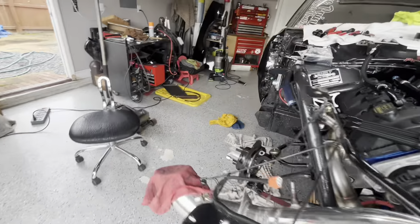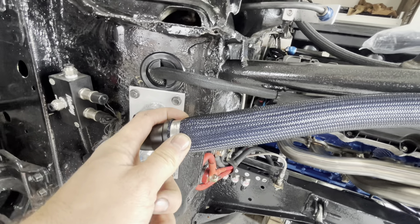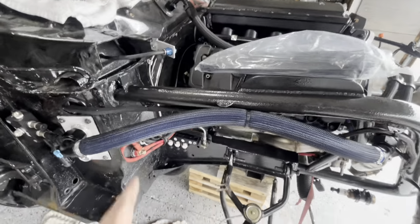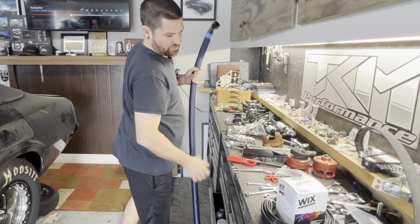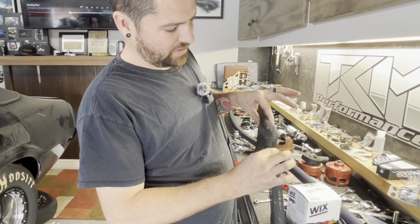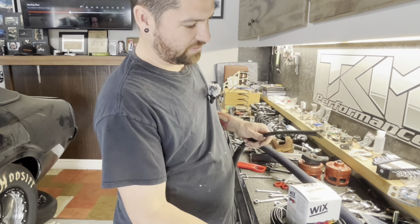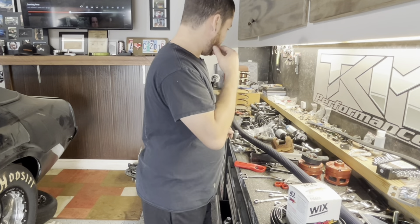On our lines I've got one made up and I'm about to show how I do it. We have a simple 90-degree fitting, then a worm clamp, then the braiding goes over the lines, and another worm clamp. I'm going to show you how I make this because it gets rid of a lot of the blue and gives it a nice subtle look that matches good with the engine. We're using this braiding - when you get it, it looks small, but when you push it in it gets bigger. You basically push it in to open up the end really big so you can slip the hose in, then you just keep working it on - it's like a Chinese finger trap, keep pushing it down.